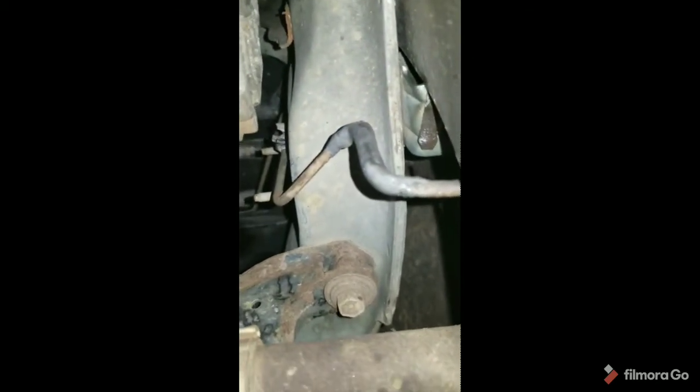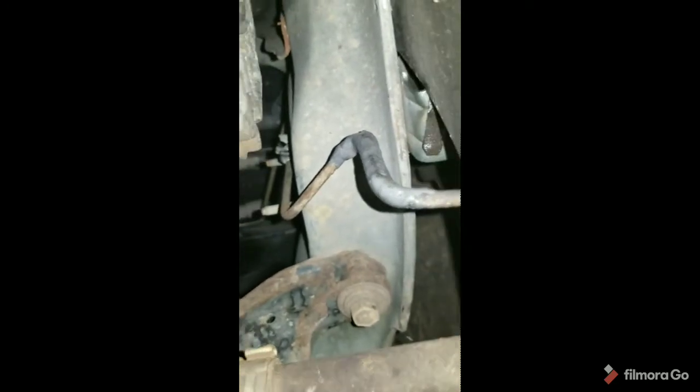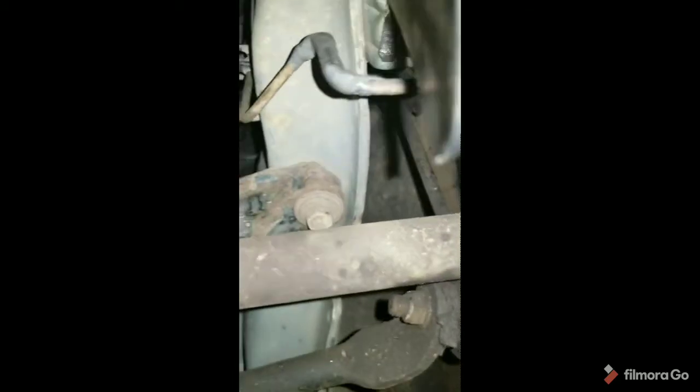I've totally pressurized my brake system. Of course this is the first day, but it's JB welded and I stopped my brake leak. For those of you who say you can't do it with JB weld — you just didn't take it off your vehicle, let it dry before putting it back on, and let the JB weld cure all the way. It's not this product's fault. JB weld is not sponsoring this video, but this is for all those people that said it can't be done. Thank you guys — y'all have a blessed day.